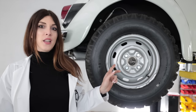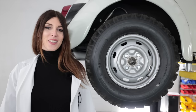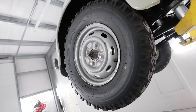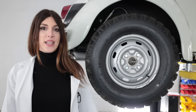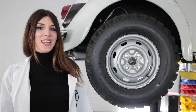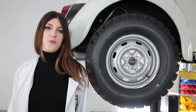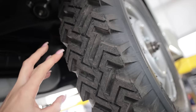That braking was accomplished with a set of 8.7-inch or 220x20 millimeter drum brakes — just little drums, but they get the job done. The wheels are the original 15 by 5.6-inch steelies, with the ugly chrome caps removed because, off-road. The tires are a set of 7 by 15-inch bias plies — Extra Traction Power King. I was close calling it something else. Beast mode off-road tire.